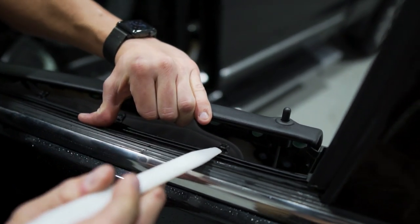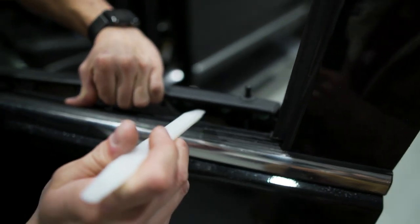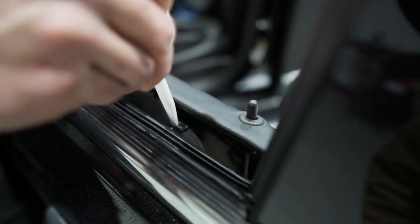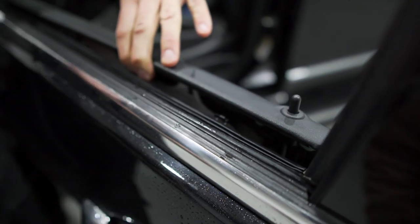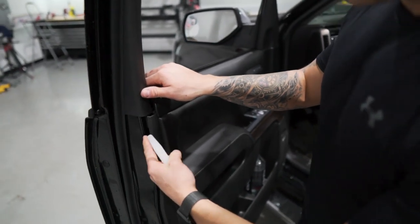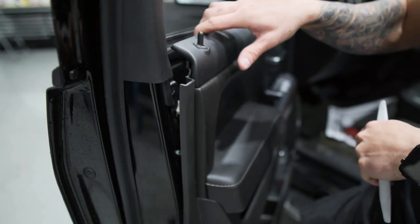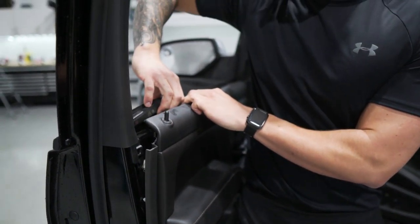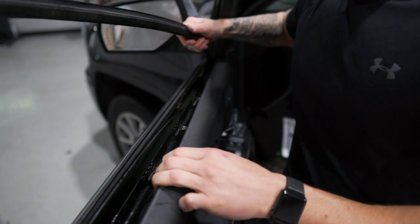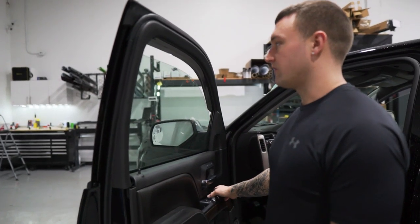You see these clips? They go into the slot down here. What we're doing is taking the panel removal tool, putting pressure on it, and then simultaneously with the other hand using the gasket jamming stick — push down on the clip. When you push down on the top of it, it releases the pressure and releases the panel. Do that across the entire top. Once those are released, pull the gasket out. Make sure you also release the back clip all the way down by pulling back on the top of the panel. Then grab the gasket with your hand, paying close attention to the clips because they do fall out. Stay close to the clips as you're pulling the gasket out so they don't fall into the door panel. Once you have the gasket removed, roll it up and we'll follow up with the inside prep.